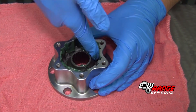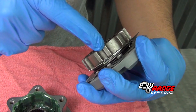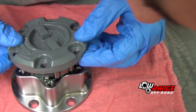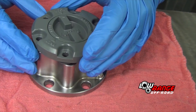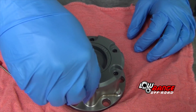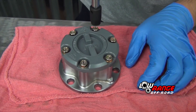Apply grease to the inside of the hub housing. With the hub cover handle still in the free position, align the double teeth and this tab with the larger groove in the housing. Once the teeth and the groove are properly aligned, install the cover on the hub housing making sure the gasket is positioned properly. Install the hub cover bolts and snug them using a 10mm socket. There is no need to torque them at this point as they will need to be removed when the hub is installed later.